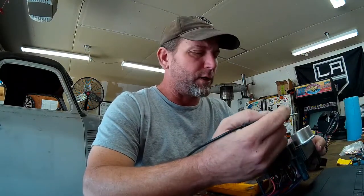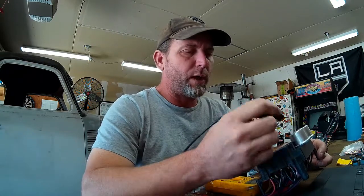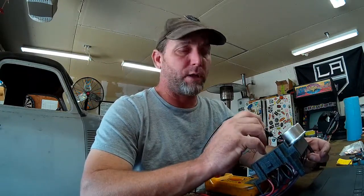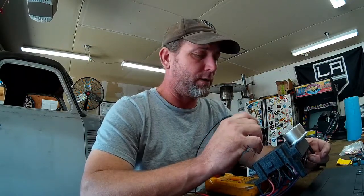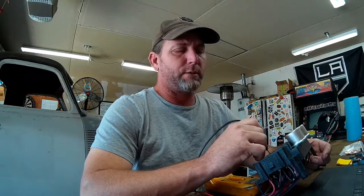You don't want your radio, wiper switch, or electric fan powered all the time by battery power — if left on, they'd kill your battery. You don't want your coil powered constantly, or your turn signals left on draining the battery. But some things do need constant power: the hazards need to work if your car breaks down, the headlights need to work so the headlight switch is live here, and your brake lights always need to be on. Also the horn circuit. So those fuses are live right now off battery power.